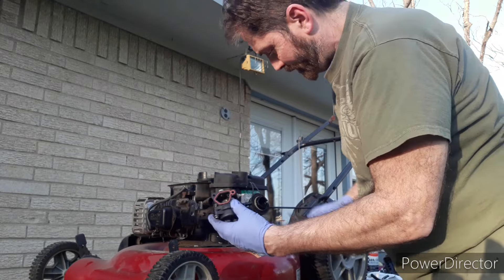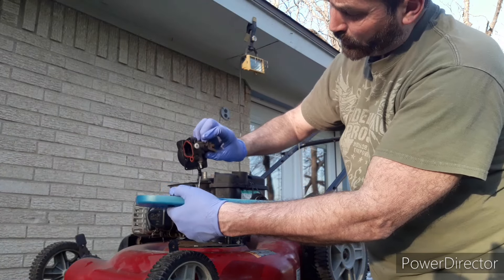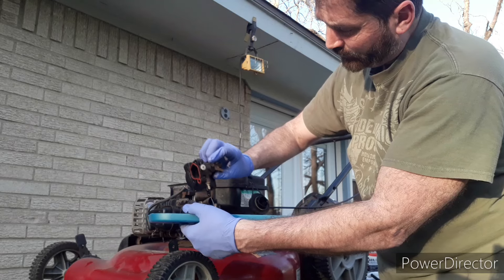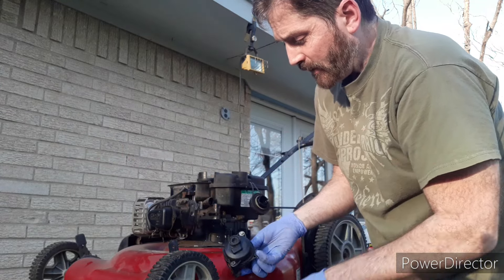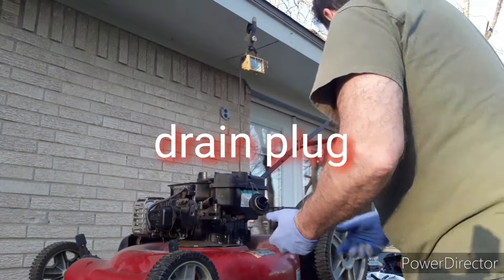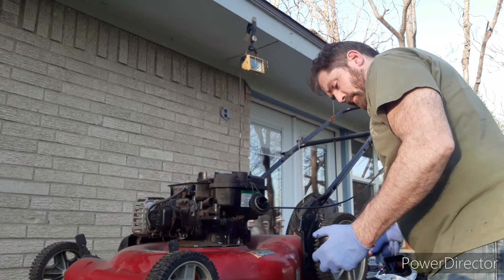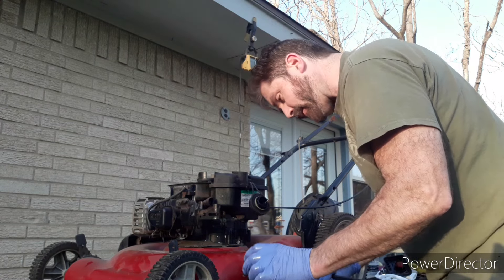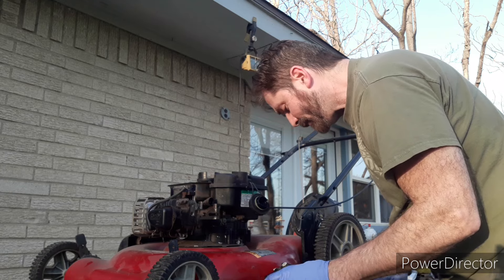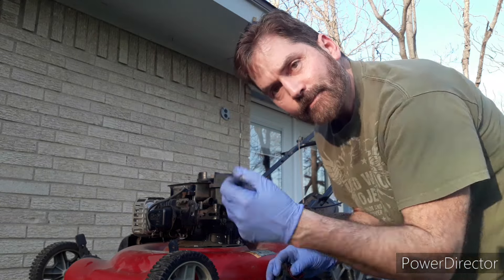Alright, this is the carburetor. Doesn't look like much. They're only about $35 on Amazon if you had to replace it — that may be what we end up doing. Dump the fuel out — this is, of course, flammable and should be done in a very well-ventilated area. Here's that Allen screw nut I was telling you about. Nine-millimeter Allen screw comes right off. And yeah, there's a good bit of the gelling that I saw in the fuel. They look like little tapioca pudding bits on there.